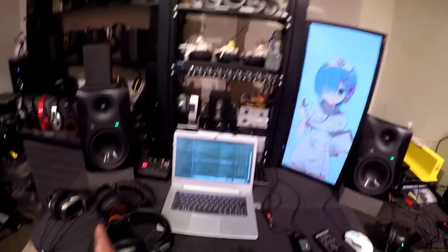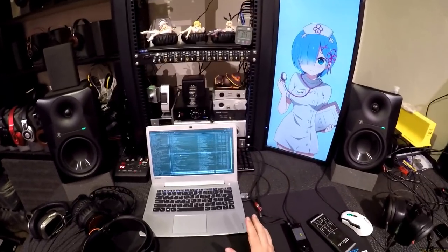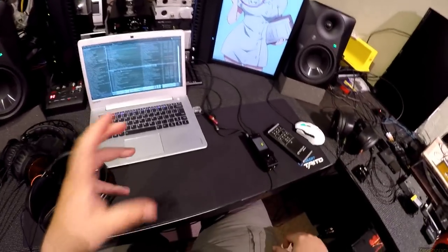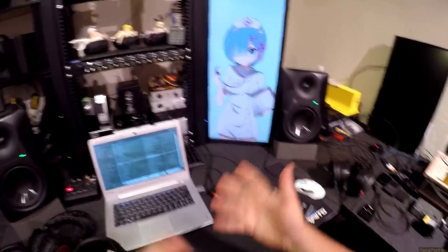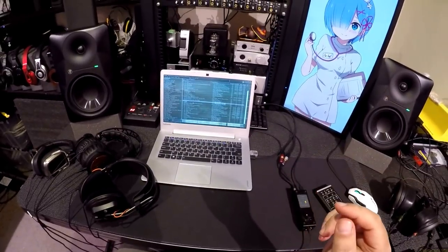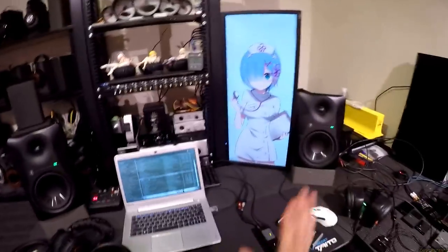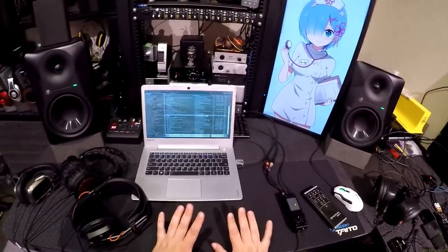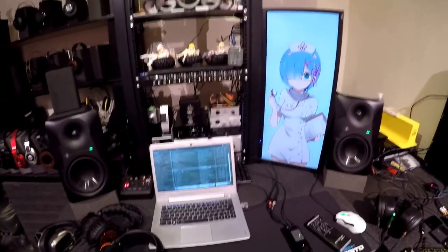Because the only reason anybody does anything is they add or fix something. Well, they fix something. The Origen Plus, the manufacturer of the chipset that the DAC was using, forgot to get their driver signed by Microsoft. So if you own an Origen and you have the Anniversary Update on Windows, you're in for fun times, which is like a 15-step process to get around that driver install, and it's a nightmare. It was so bad that I actually stopped telling people to buy the Origen, because I knew if you had Windows 10, you're pretty screwed.